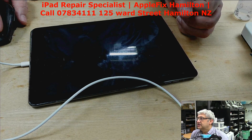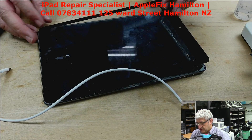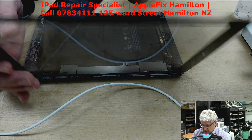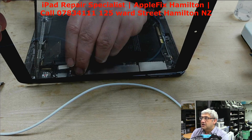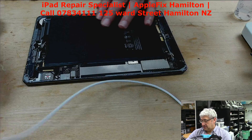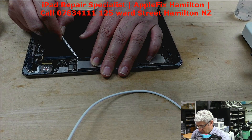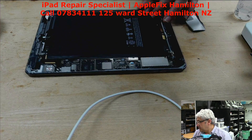For me it's a clear indication that it's most probably the U2 charging IC. The charging port has already been replaced on this one but still the same problem, so we'll remove it. I have to just take them out like this — okay, there you go. We'll check the U2 charging IC; I'll remove this shield and get it under the microscope.